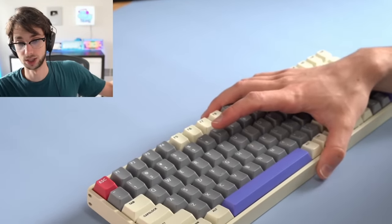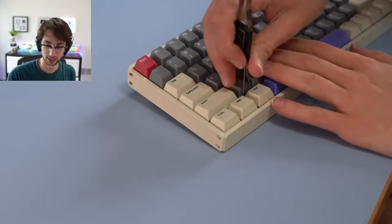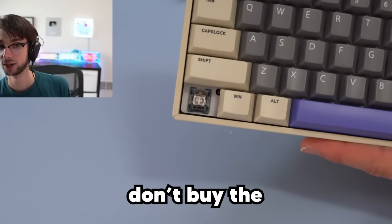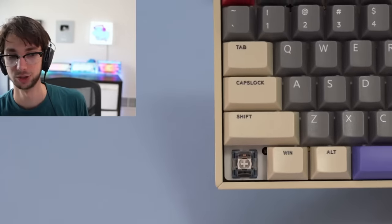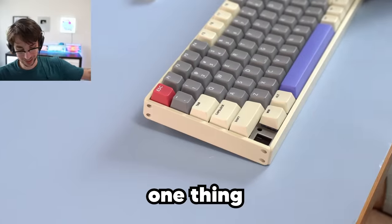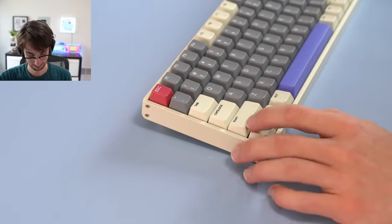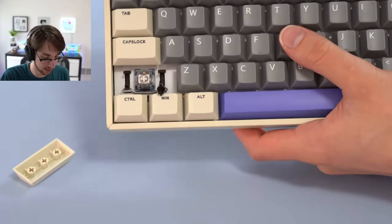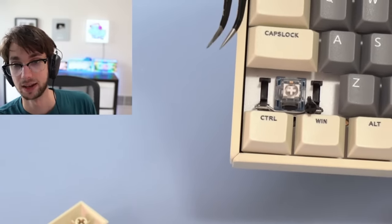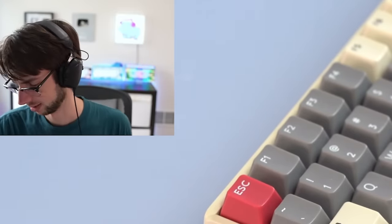The stabilizers are probably CoStar — I'm sensing it through the board. They're CoStar. Unfortunately, if you pop off a keycap it reveals the switches. These ship with TTC or Cherry switches. If you're buying this at home, don't buy the Cherry switches — the TTC switches come more factory lubed, they're just better stock. Fun fact about this board: it is hot swap, meaning you can take the switches out without desoldering. One thing about this board — pro and con — are the stabilizers. This is a CoStar stabilizer on a little wire. They sound pretty amazing from the factory usually, but they make taking off switches really annoying and they're a nightmare to mod afterwards. So if you're never going to touch this keyboard, great. If you want to mod it, not so great.